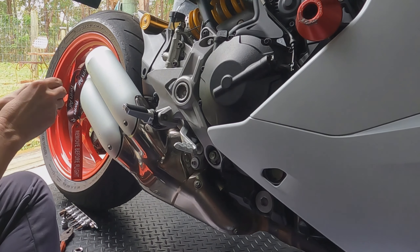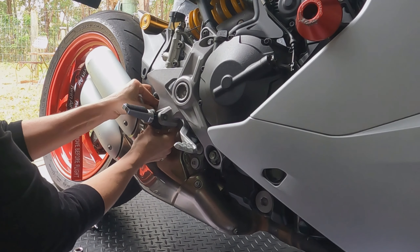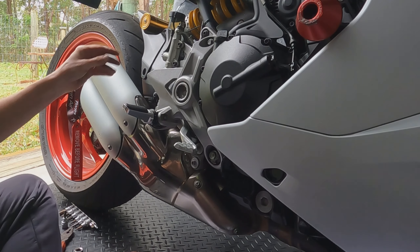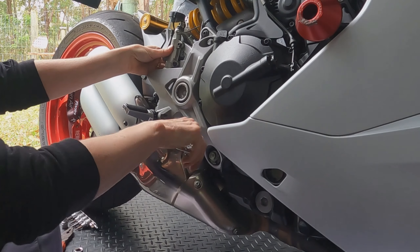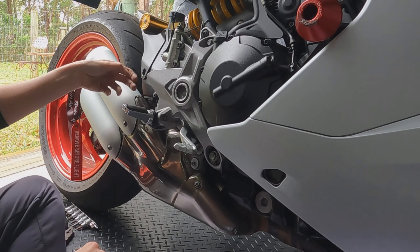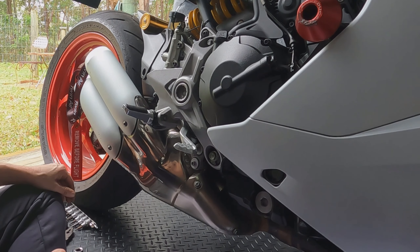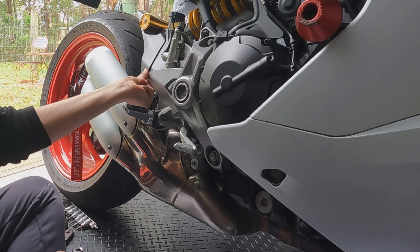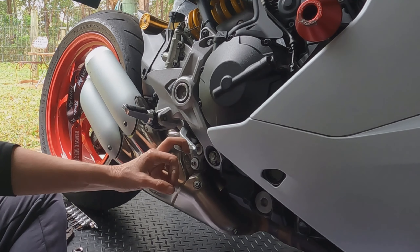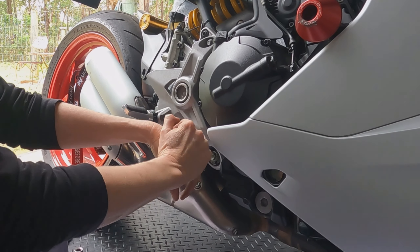The last part I have left is the special little click fastener, and that just slips on pretty easy. I think the job's done — that already feels heaps better. You could really tell the pin was bent before I disassembled it, just by the skew between the face of the brake lever and the face of the mount plate. I've got to test the brake light, make sure I've got that activating at the right time, and make sure that the brakes are actually working.